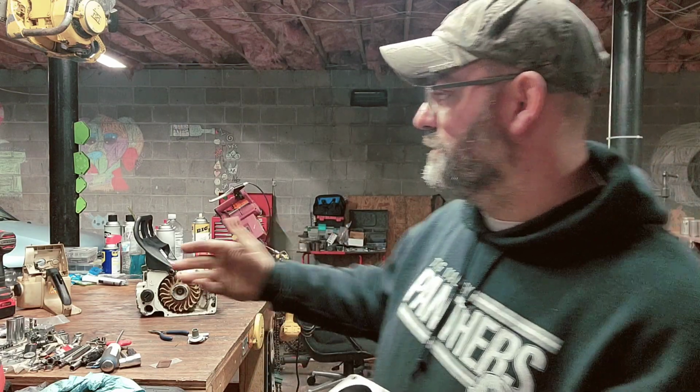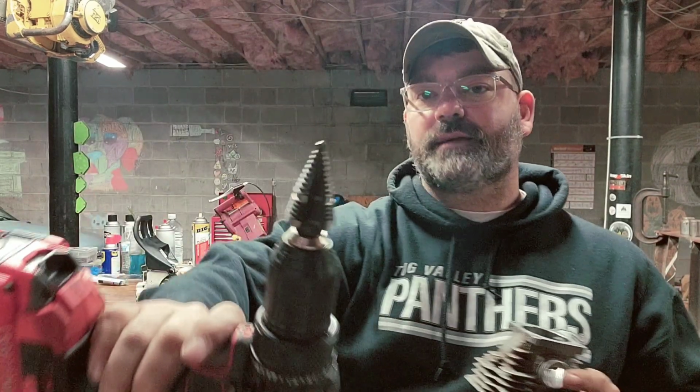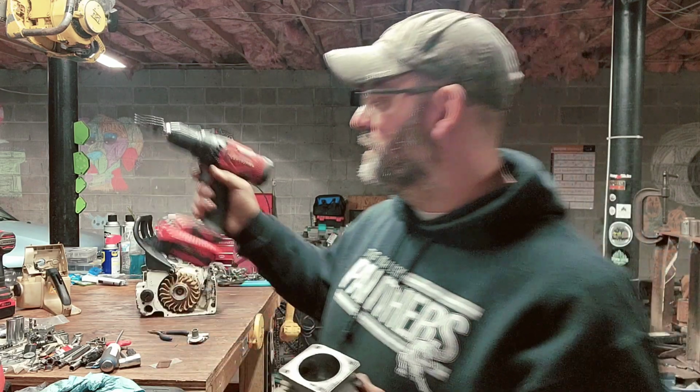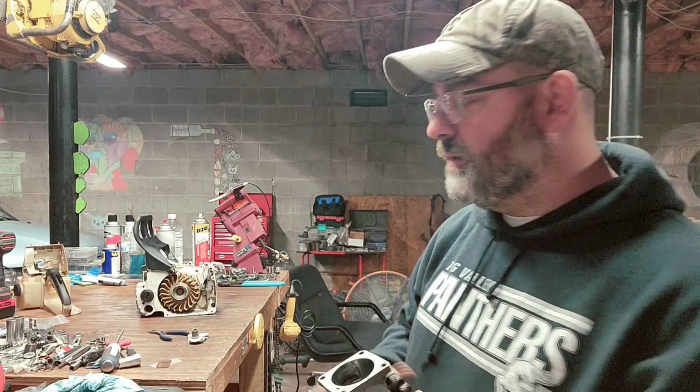One thing to note about those exhausts, the inside of the baffle, that big baffle that comes up, normally it covers the whole thing, but it's only that far down on the exhaust. So really all I did was take the step drill bit and cut into it and opened it all the way up. So it still has a little bit of baffle, not a whole bunch. And then I put another port in it because I figured it needed a little bit more breathing room. So I wanted to put it on,